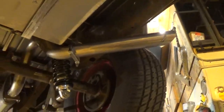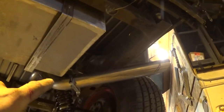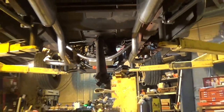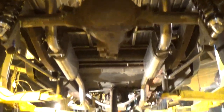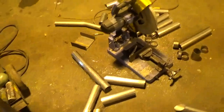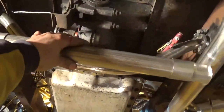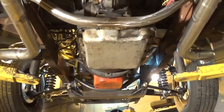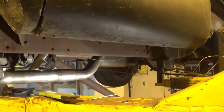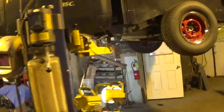I did have to come out at an angle in the back - no big deal. I probably could have gotten these shot straight out the back and worked around the fuel tank if I wouldn't have used up my elbows up here for coming inboard from those fender well headers. Otherwise, they give you plenty of pipe - I think it'll work in most cases clamping it together like I said if you don't have a four-link. Got plenty of leftover pieces and parts. The crossover pipe is also going to fit in here pretty nice right under the tail of the transmission - I'll put that in too. It seems to be worth the money, but it's probably going to look a lot better if you have a welder and the capabilities to put it together properly.